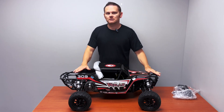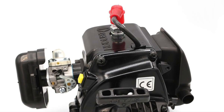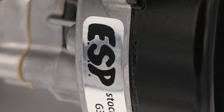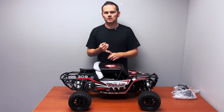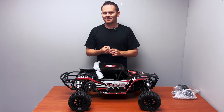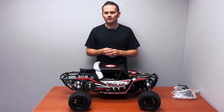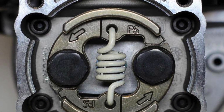This is a perfect setup for someone who has an existing engine and they want to install a more powerful engine — maybe they want to install a Zenoa engine or something larger. So what will you need from a new engine such as a Zenoa motor? You will need to have the Zenoa engine and a muffler, something like the CY high flow exhaust canister if you're just looking for a muffler. There are tuned pipe options available as well. Your engine will need to have the clutch assembly, so that would be the clutch housing and the clutch shoes.